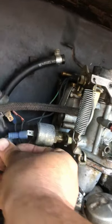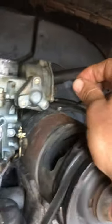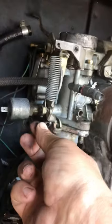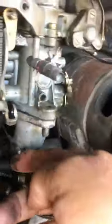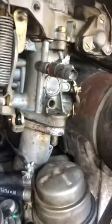There's the fuel cutoff valve wire and you've got your choke wire — this gives 12 volts to the choke, which comes from the coil. In fact they both come from the coil. Then you've got this little small barrel that slots in here, and that's where the throttle cable comes through. I just use two pairs of pliers to undo the bolts.